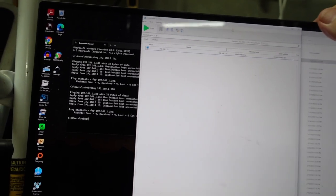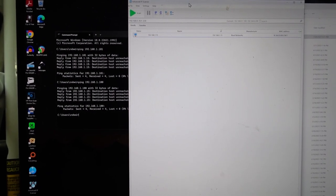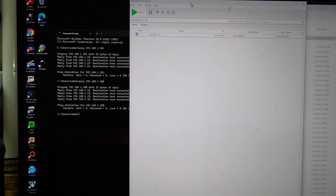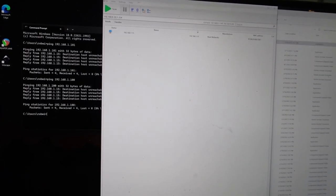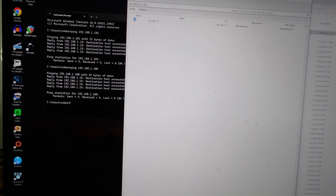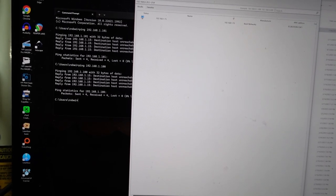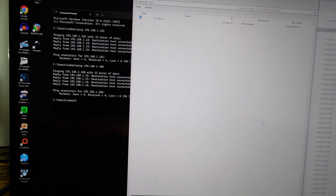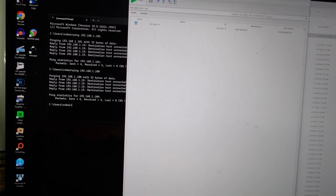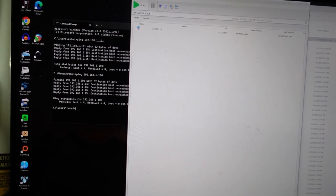After a little digging, it was showing me every item that was available when it did the previous scan. I found a setting that would show only the live connections. So right now, the only live connection on this network is this laptop, and the router is not showing up. I should be able to reach the router at an IP address — that is something I should be able to do. But I can't find a live device on this network other than this laptop.